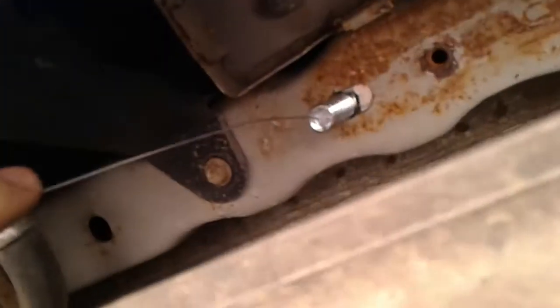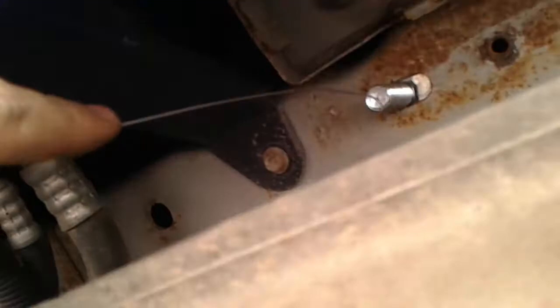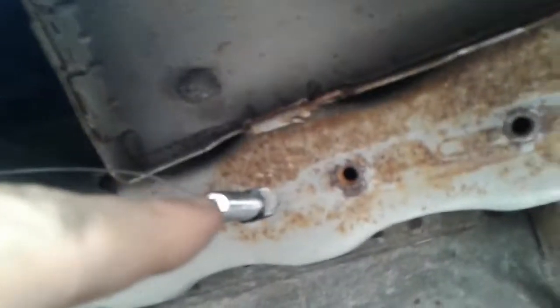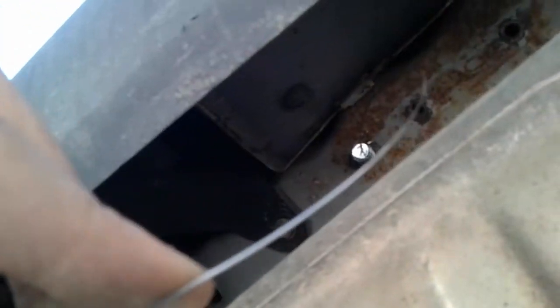You have to run the wire and bolts through the access hole. What worked best was taking the wire with the spring end first, threading it through the holes so I could grab the big end through the access hole. Then I grabbed the springy end and held it through the access hole, keeping the wire hanging through that hole. You do not want to lose this up in there — otherwise you have to start over.